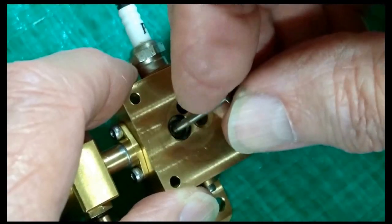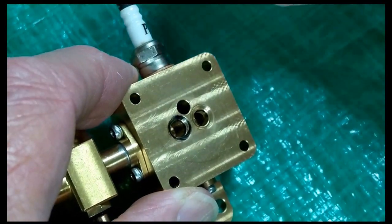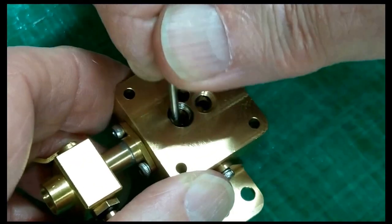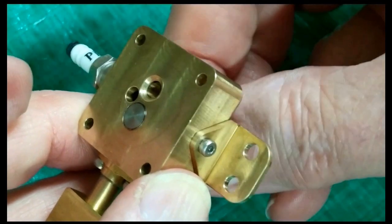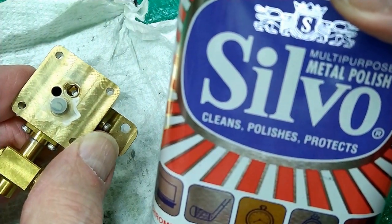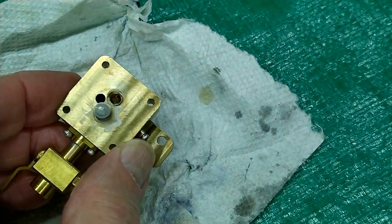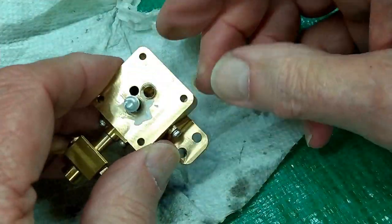When I look at this with my magnifying hood, it rubs away that marker except for right here. And this one over here was much the same way. I'm going to do a valve job on this using toothpaste or silver polish — I haven't decided yet. I'm going to put that on there and try to spin this by hand, which is tedious. I'm trying a little bit of this metal polish; it's a little less aggressive than Brasso. I put it on the seat and the valve.